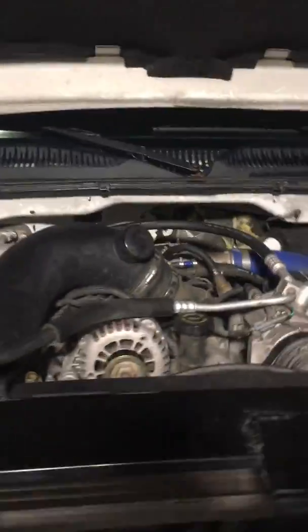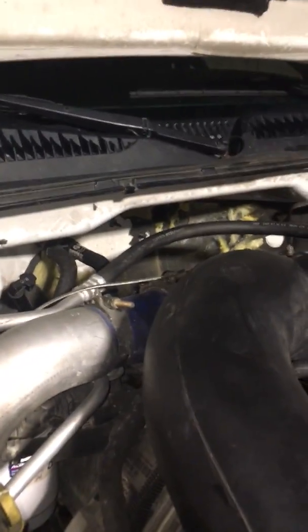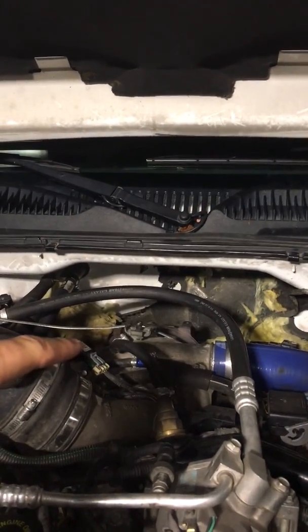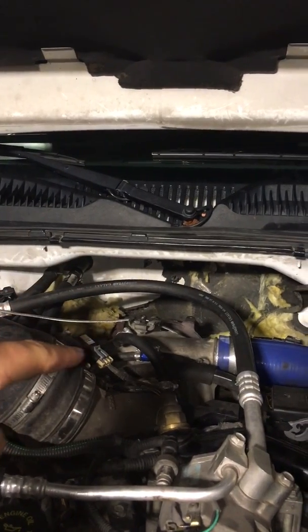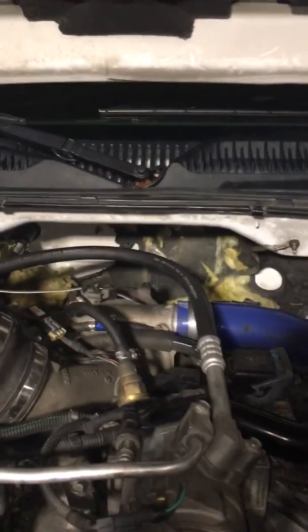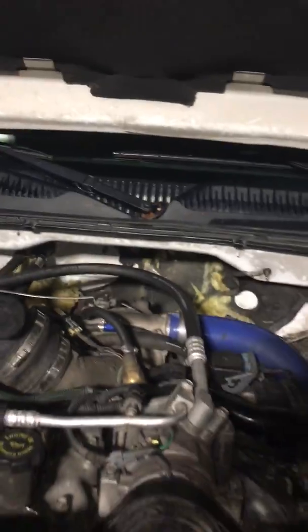But what you really want to do is soak those bolts. Get that serpentine belt tool. Another guy on YouTube did a video using it, and that's what I used for the 4. For that one, make sure you don't use an open-end wrench to get it off. And for the bottom one, if you can get the tool on it, good. I had to use a ratchet coming out this way, and I just laid across and yanked it.